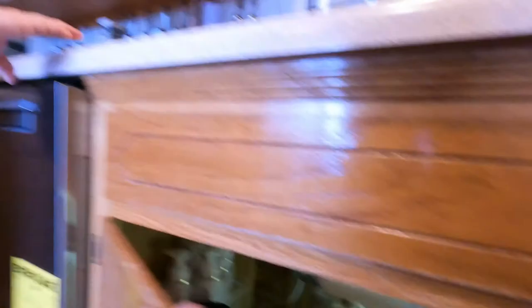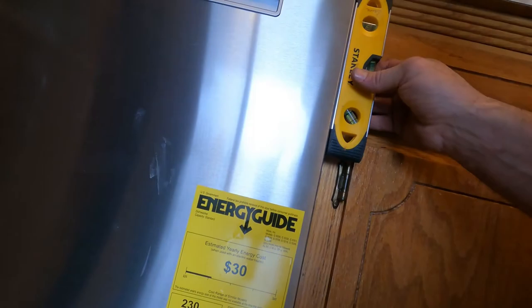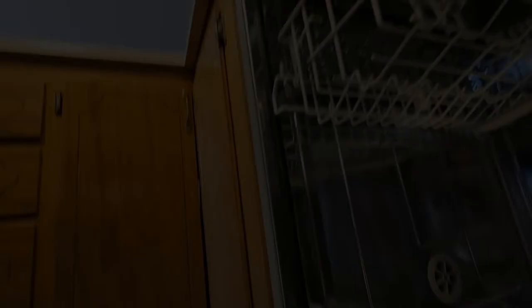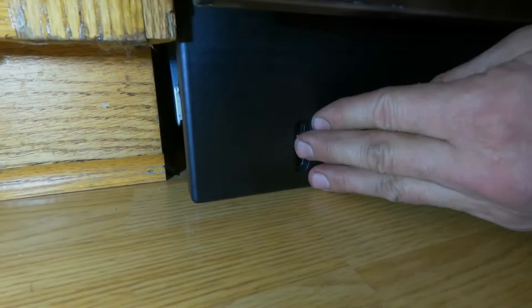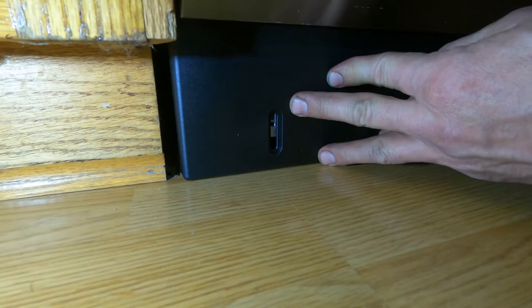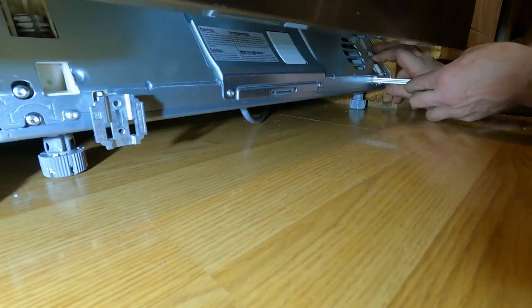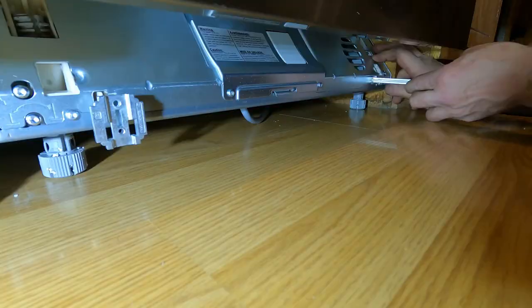Is that a good height? Even that even seems like a good height. Once we had the dishwasher level and where we wanted it, I'm now going through and anchoring the dishwasher to the cabinetry. There are four holes that sit in front of the dishwasher seal that you screw through into your cabinets — it works pretty good. Then they give you rubber plugs to plug those holes. They have it here to cut it right — in here to cut this. So that's going to be how that goes, we're going to have it at the bottom right on the floor just like that.